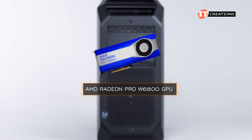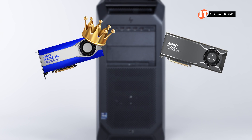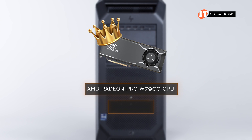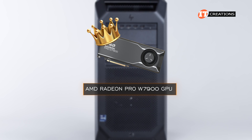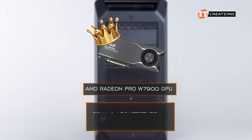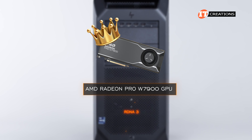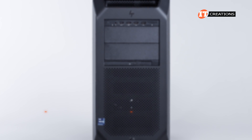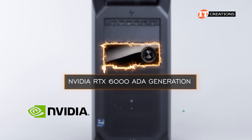The Pro W6800 used to be AMD's greatest GPU ever, and it still says that on the site, but I'm going to assume that honor is now in the possession of the AMD Radeon Pro W7900, which consumes up to 295 watts peak. The W7900 is advertised as a professional graphics card with RDNA 3 architecture and 48 gigabytes of GDDR6 memory, still with a PCI 4.0 interface. RDNA 3 is the next-gen answer to RDNA 2 on the W6800. The NVIDIA RTX 6000 ADA is also supported on this platform, along with quite a few others from both NVIDIA and AMD.